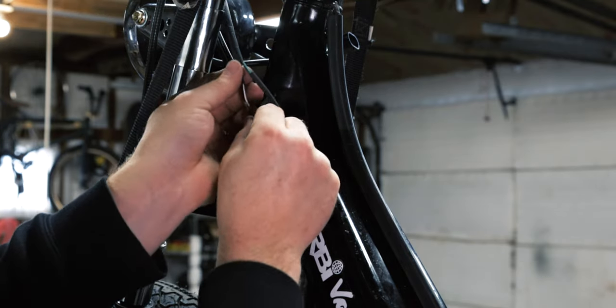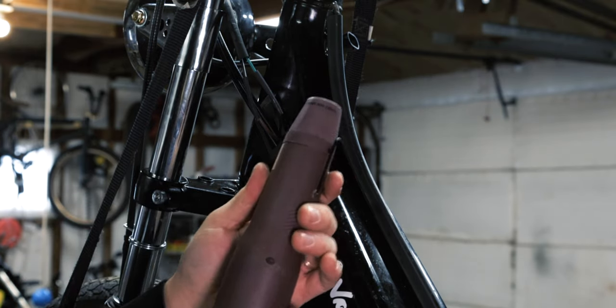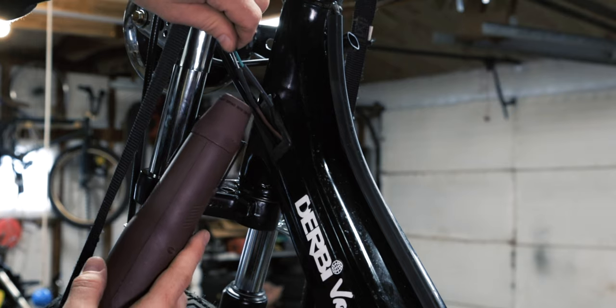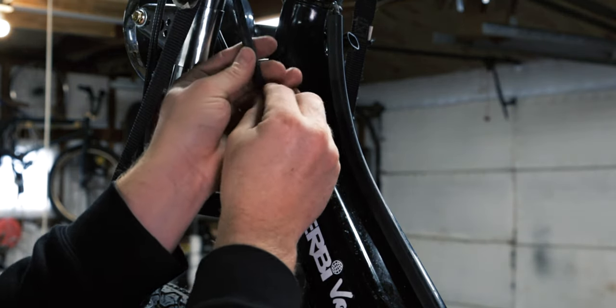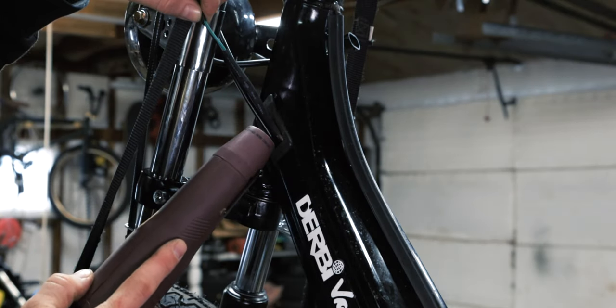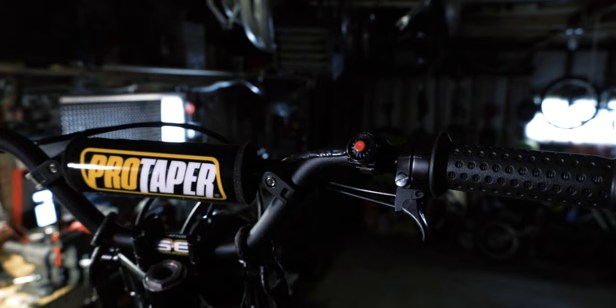There's one and there's two. Then I use a little heat gun, and now I can slide over the larger shrink wrap. That goes over, then we can pull these wires in a little bit. There we go — it's all wired up. That's all it takes to wire up a kill switch. It's super easy: two wires, just ground out the coil and you're done.